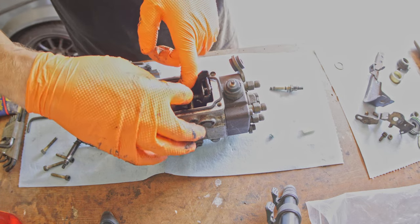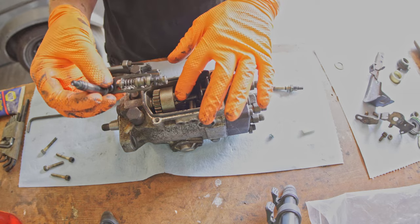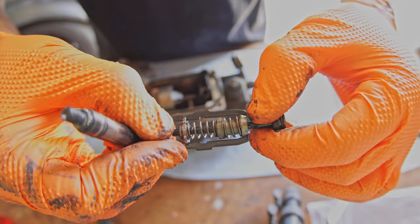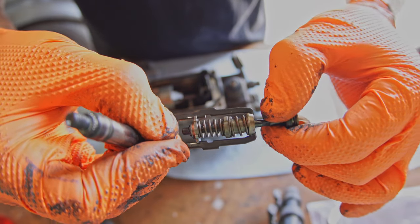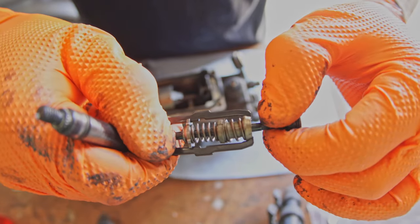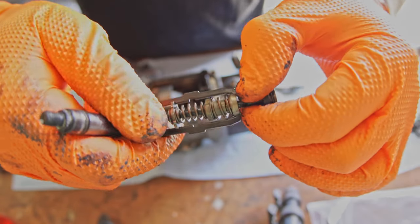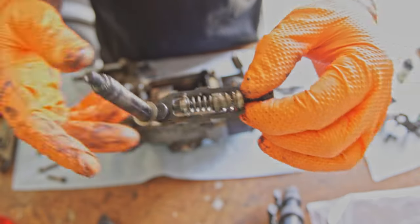So what we're gonna do is basically change how these springs interact with this governor. Watch this. The governor would push back on the throttle, even if you're at full gas, and this would happen. So even when you're twisting the throttle, you have your pedal on the floor, you hit a certain RPM, and bang, it's cutting fuel, allowing those plates to go the other way. So we're replacing this long spring right here with something solid.